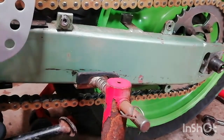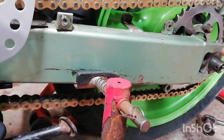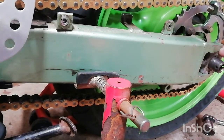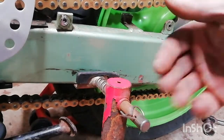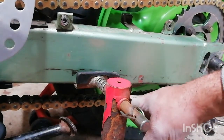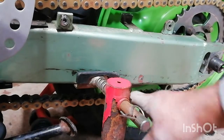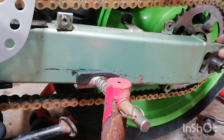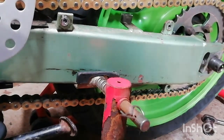So I'm going to show you how to set up 30 to 45mm worth of tension on your chain equally. So right of screen I'm on the axle here. I've measured off my graduations — I actually took it out to the one I marked and showed you earlier; it's way too tight. This is a new chain and the old one was slack, so over time you will be adjusting your chain. You should be looking at it depending on how often you ride — maybe monthly, or if you're doing a lot of miles every week, maybe weekly. So I am two or three mil shy of the last mark, so I've adjusted that out and once I'm happy I'm going to show you how we measure.